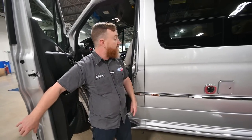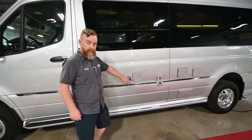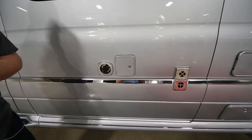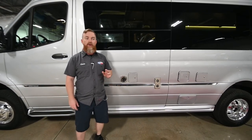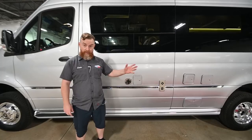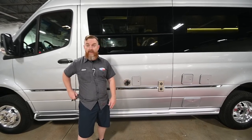Heading this direction, we have the city water connection here next to the fresh water fill. The Airstream city water connections have built-in pressure regulators — there's no need to add external ones. They're 50 psi and are also plumbed through the onboard water pump. So if you're at a campsite with weak pressure, you can turn on the onboard pump and it'll boost pressure at the faucets. Note that city water will not fill the onboard fresh tank — it feeds the faucets directly.